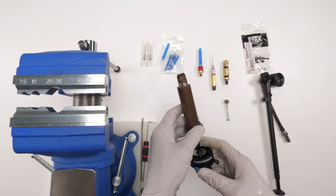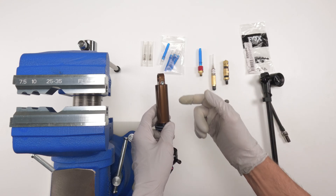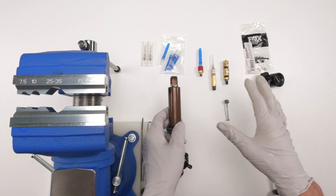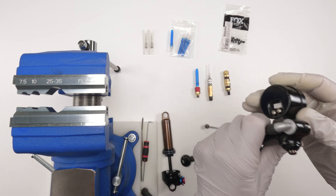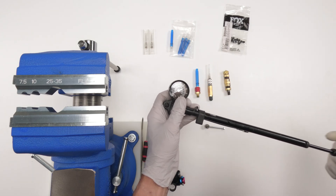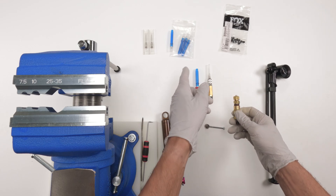This is going to be a one-shot video, only about doing this. I'm going to try to go into as much detail as possible so you can successfully get this part of the job done. As for tools, at a minimum we're going to need a high pressure shock pump. The back screw came loose again — you need a high pressure one. We've got to go up to 500 psi with a DPS. You can't do that with a regular shock pump; it ends at 350 on most of them.